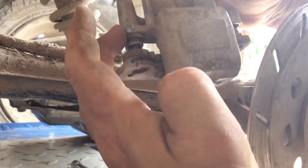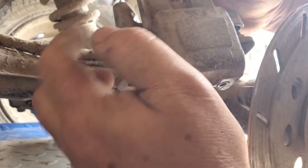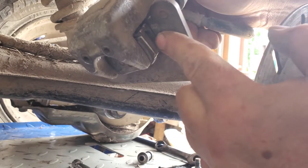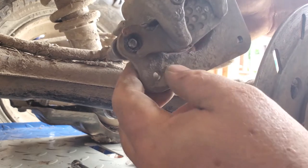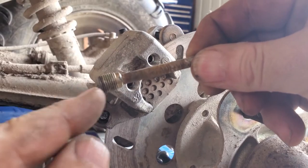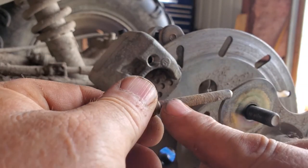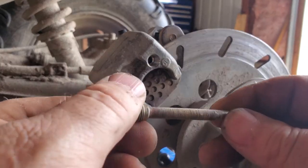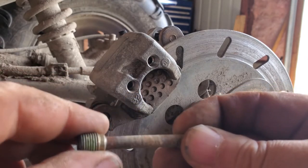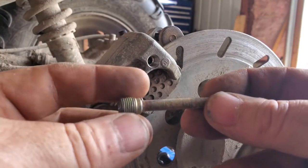Normally the caliper will slide back and forth - you can see I got the boot out of this side, it wasn't seized, but that side is. When they seize, the caliper can no longer move so it puts all the pressure on one pad. Not a big deal - we'll unseize that and put some fresh grease in there. The pins are out now; you can see the threads are on the outside and the pin goes all the way through, exposed to all the dirt and rust. They're tight to get out - just keep spinning and pull gently with your fingers. Don't grab onto it with vice grips or anything like that.